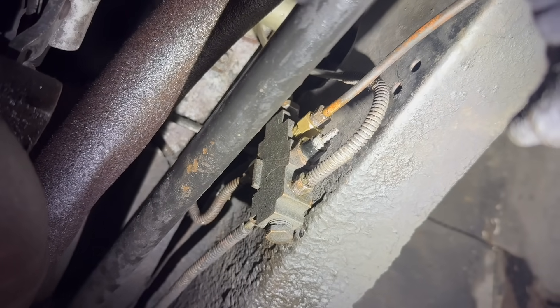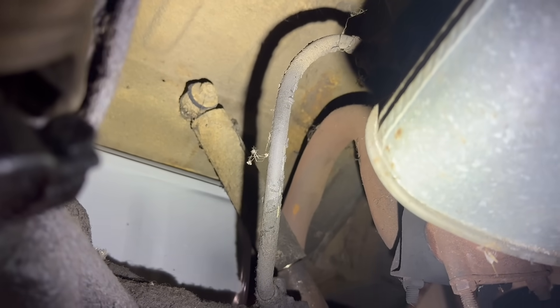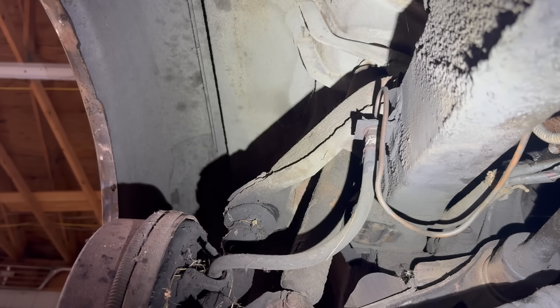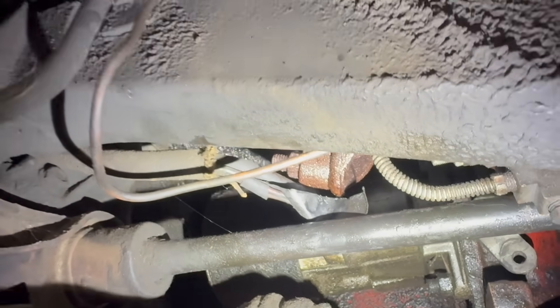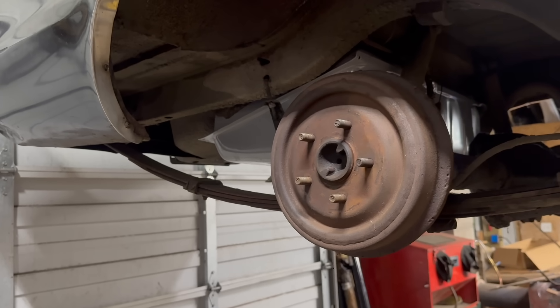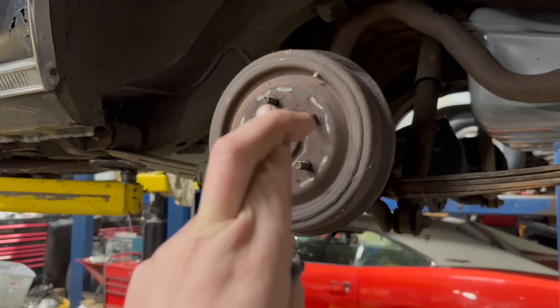It's possible to have a brake warning light with this setup, but we won't be wiring that in this particular car — if the pedal gets soft, that's going to be a clue that there's something wrong. We had every intention of putting fresh brake hoses and wheel cylinders on this car all the way around, but unfortunately the parts that RockAuto sent us are kind of the wrong ones, and they got here some weeks back so we can no longer return them. The good news is these rubber hoses are not original, and none of them are horribly dry rotted or cracked up. They're all flowing fluid nicely, and I think we are fine just leaving these in service. We're not fine leaving this starter wire on the exhaust manifold though — we'll go ahead and fix that. David already bled these brakes and had a very firm pedal; none of the wheel cylinders leak now.